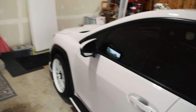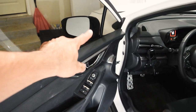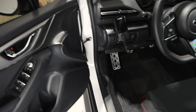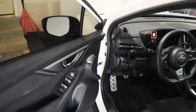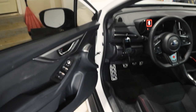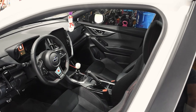On a high level, the steps are pretty simple. First we've got to pop the mirror off, obviously. Then on the inside, we need to take off the door panel. Then behind the door panel, there's a bunch of bolts that hold the mirror assembly in, which obviously will have to be moved. The cable does need to be run through — we're probably going to go with cutting through some rubber grommets. Run the cable on the inside, tap it into a couple of cables underneath the dash, and then we'll flip and do the passenger side, which is the exact same steps.